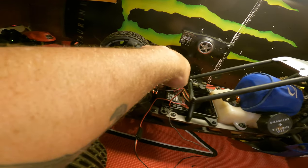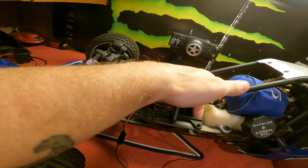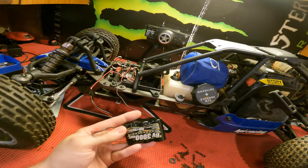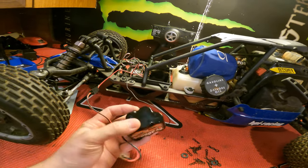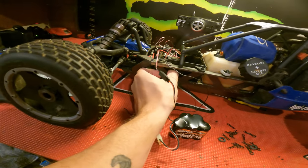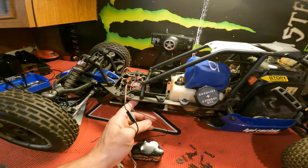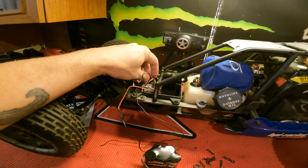I think this whole box will lift out, so I'm probably gonna do that and clean all this crud out, and just put the battery back in here. This thing was 100% flat, no life at all, and I put it on a little slow charger overnight, and it's actually holding a charge now, so that's good. If we cut the car on, we can see we got power and everything. It's freaking out for whatever reason. That could be a bad thing.